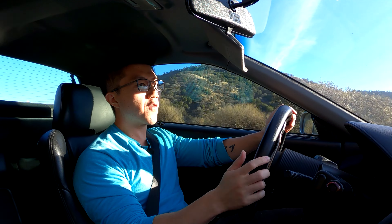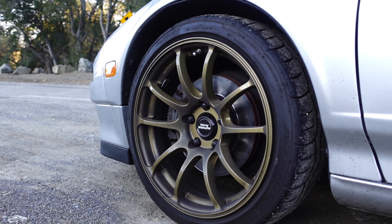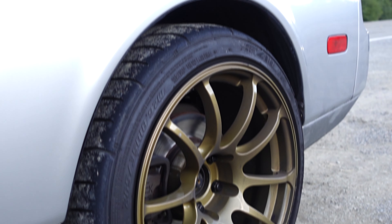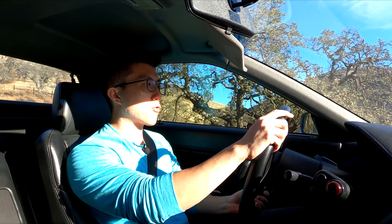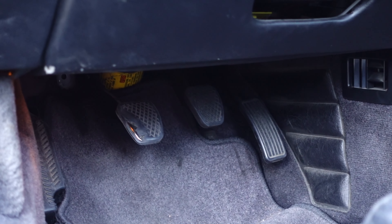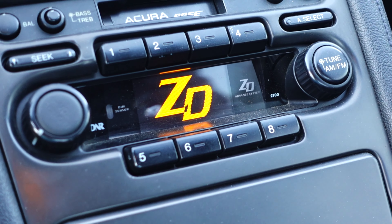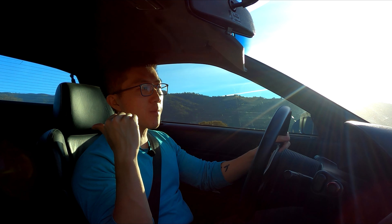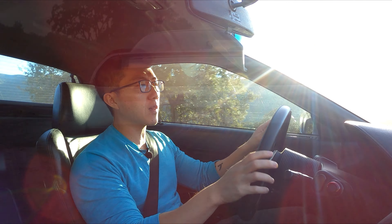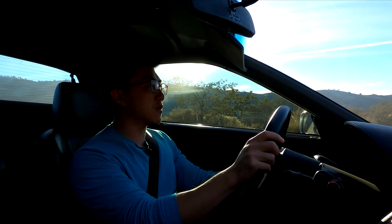Let's talk about some of the things I love about this NSX. All I have in terms of mods is a set of 17 and 18-inch staggered Advan wheels with Falken 615K+ tires, Winmax W3 pads front and rear on stock calipers and rotors, a Momo 350-millimeter tuner steering wheel, and a Science of Speed shift knob — a replica of the Type S shift knob. There's also a custom-installed Defi ZD gauge behind the stock radio screen that lets me monitor oil and water temps, battery voltage, fuel pressure, and oil pressure. And of course my Pride V2 RFL — Really Effing Loud — exhaust. That's it in terms of mods; this car is pretty much a stock NSX in terms of driving feel.